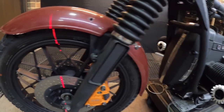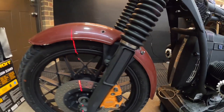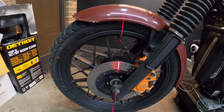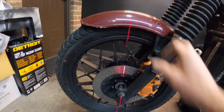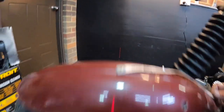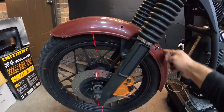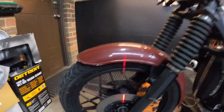As for the guard, I've armor blacked the brace up behind there. This is the OEM guard. I've got the laser out again — if I go from the start of the guard at the center line of the actual axle, that gives me about 190mm. From there back to the actual center of the fork line is about 190, and then probably another 190 down, making 380 total. We'll see how that looks.